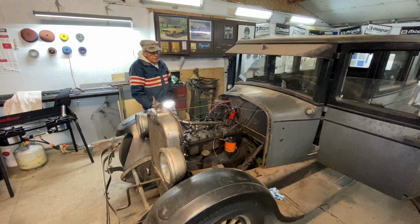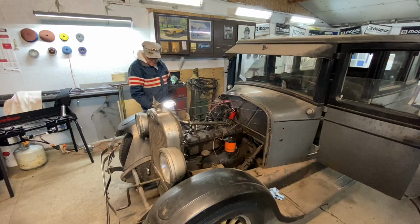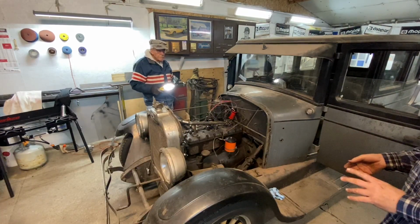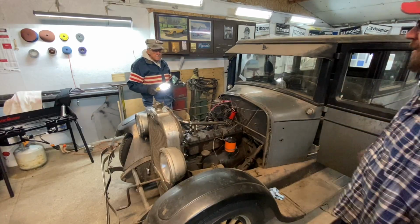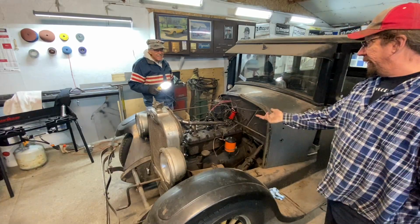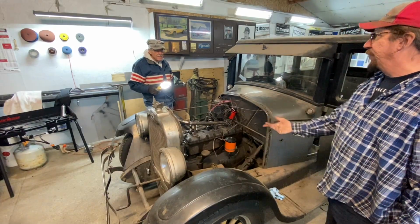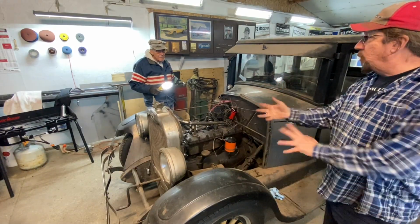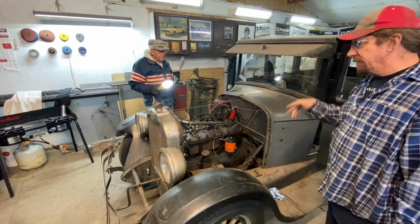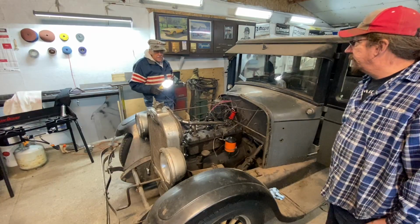Any chokes at it the last? I shut it off before I got out the first time. Yeah, it's a little bit tricky getting it started because you got to use your heel on the starter and your foot on the gas and your hand over on the choke. Otherwise, it just starts and dies. Normally, when I've started it before, it's taken three times before it took off. And I thought this time I'll work the throttle a little bit better. And it one time died, and then I think it was the second time it started. Yeah, with a foot starter.